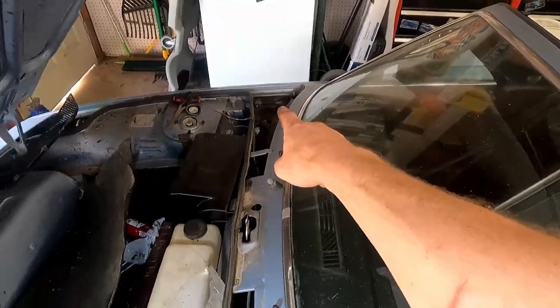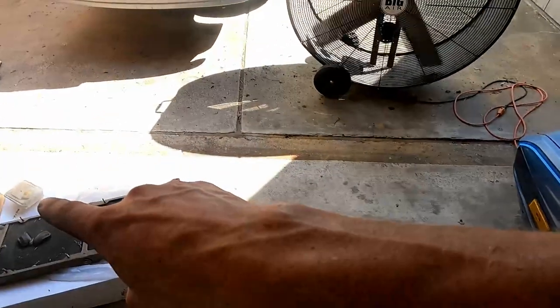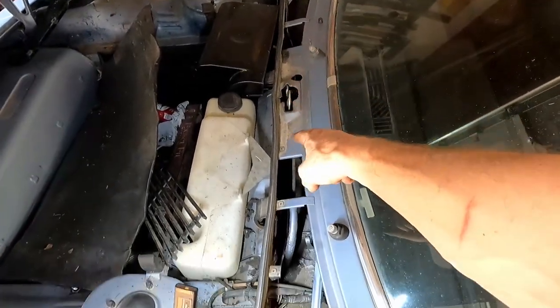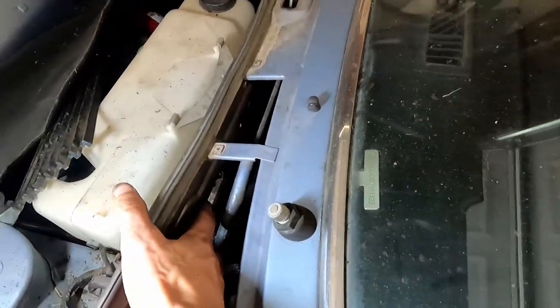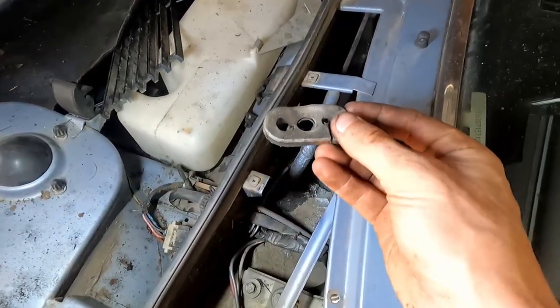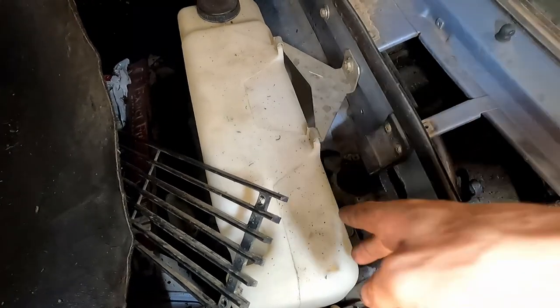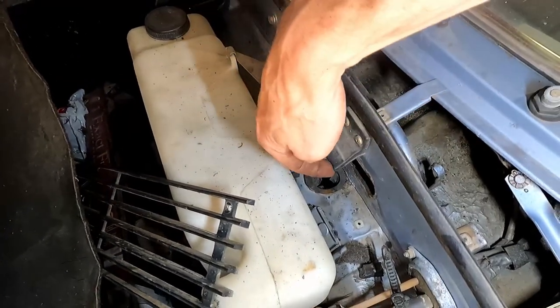I took them out and they're clean. They're finishing drying there. I just used some brake clean. We're gonna run the rubber line just like they did originally here. Comes through a grommet in the firewall, well, I guess whatever you want to call a firewall, comes out and then down through this oversized grommet here, and that's where your pedals are.